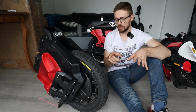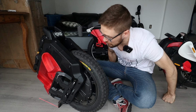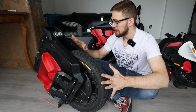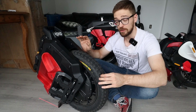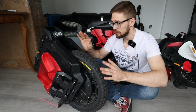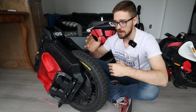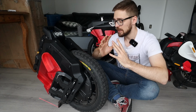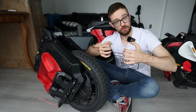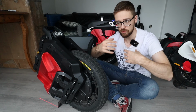And one more thing I wanted to talk about, because this is something that we will really see after an extended period of time of using this wheel. Mainly this is the stability of the frame, because this thing is really a bit like origami. My main concern is whether this thing will stay stable over 1,000, 2,000, 10,000, 20,000 kilometers, because essentially we have 2 different pistons of suspension, so they will work differently. One is for rebound, one is for compression, and either way they will work a bit differently. And usually what you get in bicycle front forks is 2 forks, 2 pistons, and a bridge that makes sure that both parts will stay symmetrical and work well.